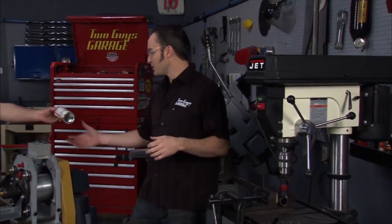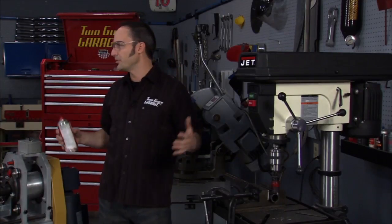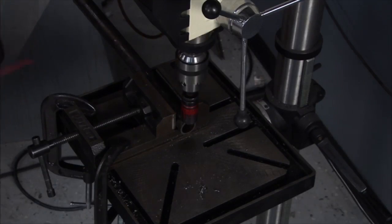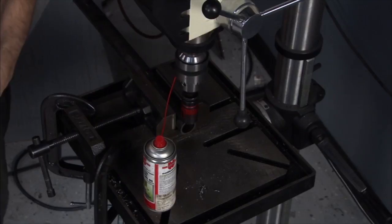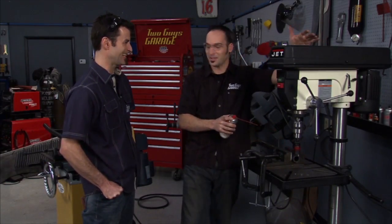What's nice is it cuts so fast, but all the adjustments let you set it up real quick. Now, there's a lot of ways to do tube cutting. You can do it with a grinder. You draw your fish mouth on there, you grind it out, throw a lot of material everywhere. You can use a hole saw. You can use it on a fixture type with a hand drill. Works pretty good, but after using that one, it feels a little archaic.